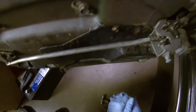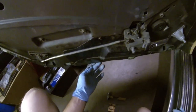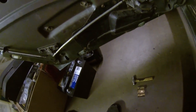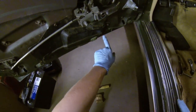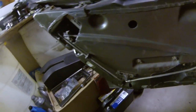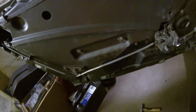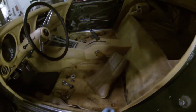Save your old bolts and make sure everything's going good and solid. This car had an issue where the panel actually dropped and bent this whole piece — it got caught up in the door jamb, causing some paint loss. Missing hardware is never any good. He only had one bolt holding this panel on, down in the corner, and every single one of these holes was stripped out pretty bad. I'm going to do the same fix with the panel mounting hardware, and this door should go together fairly tightly and look pretty well.